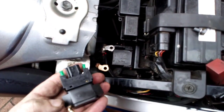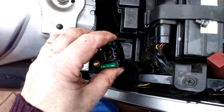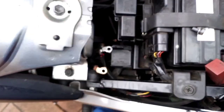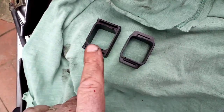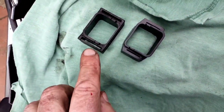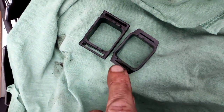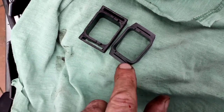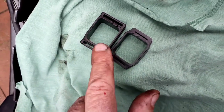Reassembly is the reverse — not much to it. We just got to stick this on there, put the terminals on, and see if it works. However, we're going to have to reuse the old rubber cradle, because the slot dimensions on the new mount don't match. Even though it's rubber, there's absolutely no way it'll go on the lug without splitting or breaking it, so we'll have to reuse the original one.